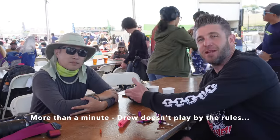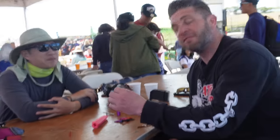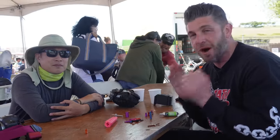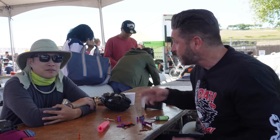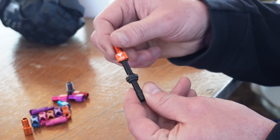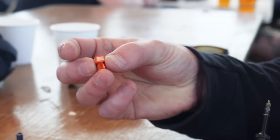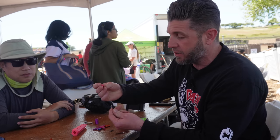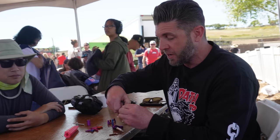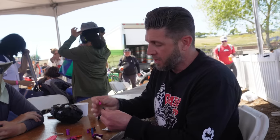We are here with my good friend Tomo. He's flown over with some very cool bits — his latest project is Clever Standard. Today we're going to show you a couple of really cool bits. This is your valve core cover — it decorates your bike in a number of colors. However, it's also a valve core remover tool if you flip it over. It is also a Presta-to-Schrader adapter. Or you can thread that back on if you've got an air compressor or gas station, and use that to get massive inflation to set the bead on your tire. That's three useful functions and one decorative function — four in one.